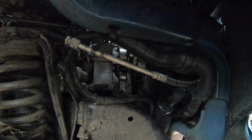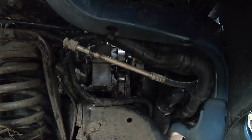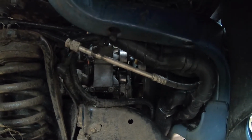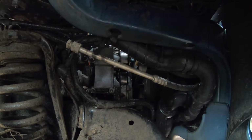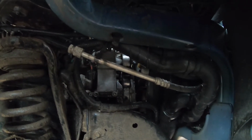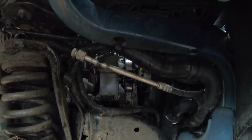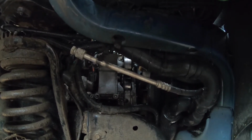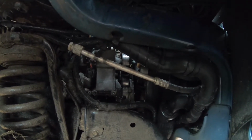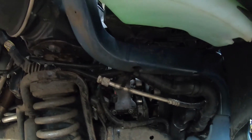I did it with a 3/8 ratchet, but I couldn't fit the bar on, so I used my left hand to pull the ratchet to loosen the tensioner, and I reached around with my right hand and slid the belt off of the alternator. We'll see if that still works when I go to put it back on, but because I'm here alone, it's the way I had to do it.